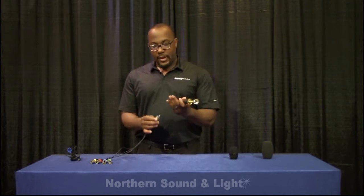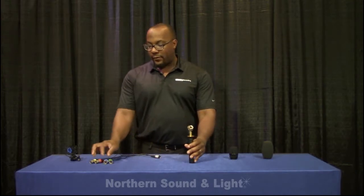In order to get that 5.1 or 4.1 sound out, we have this breakout cable that comes with the microphone. You plug it in, take these four channels, and plug it into a four-channel interface. In order to take that sound and orient it, there is an A-to-B converter — a free download on Sennheiser's website.